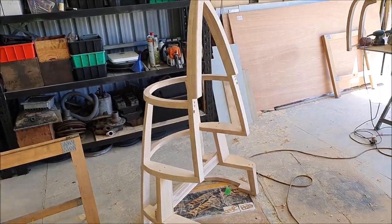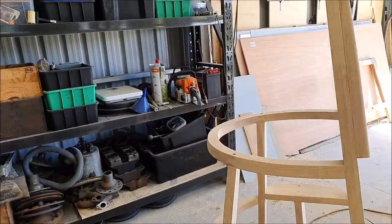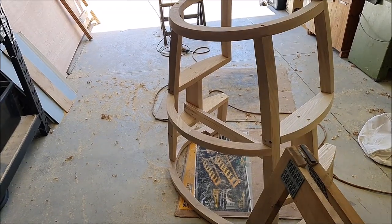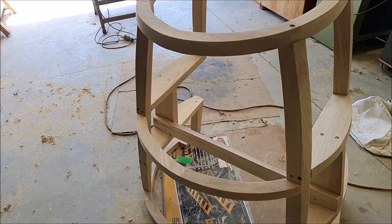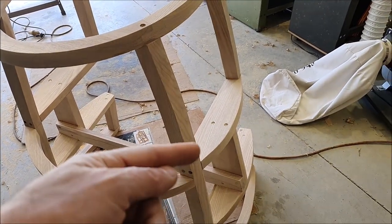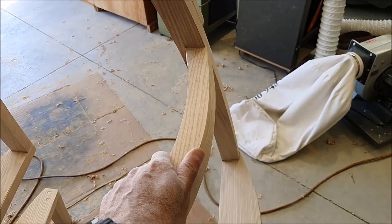It's another day, really nice and sunny. I'm working on the frame some more. I've added in the hoop - that's the front of the boot opening - and I've started fairing everything in and smoothing it all. I've been using the spokeshave, which works reasonably well, but I find the easiest way is just with the belt grinder with 60-grit belt - I can take away a lot of material quite quickly. I've fixed up the sides and had to take quite a bit off, but it all still lines up nicely. This is just rough at the moment, but you start seeing why I made all these pieces slightly oversized.